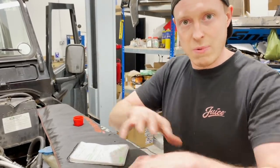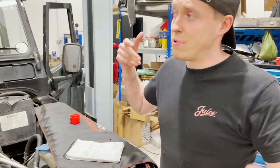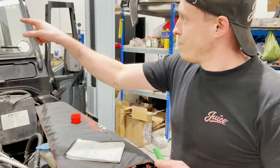And it's just really good for these earlier TD5s and the sort of 300 rear windows. They're not like a sealed unit. You can split them all down, rebuild them all properly with the correct seals, clean everything up, reassemble it, route it all back onto the body, and that problem is done. So I'm going to jump on that now and drill these windows out.